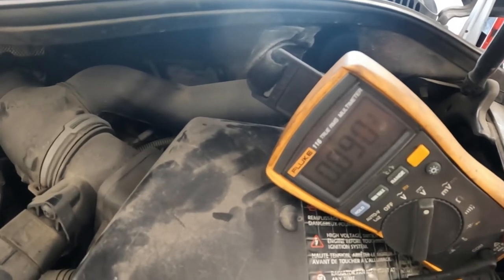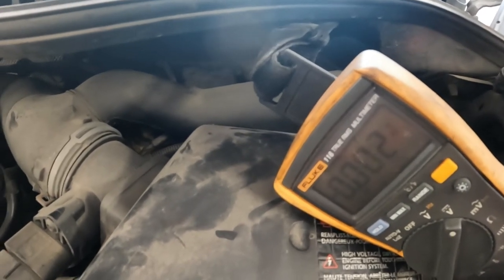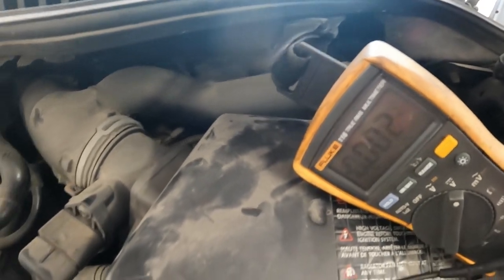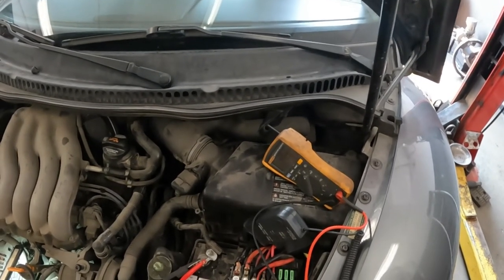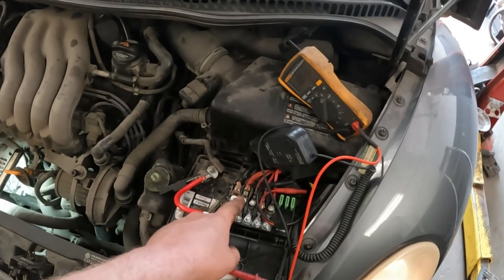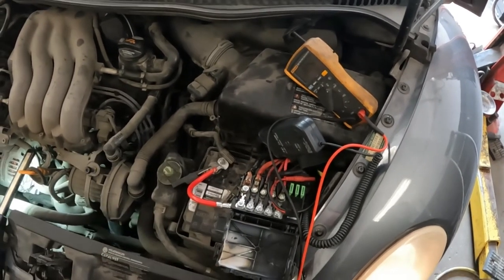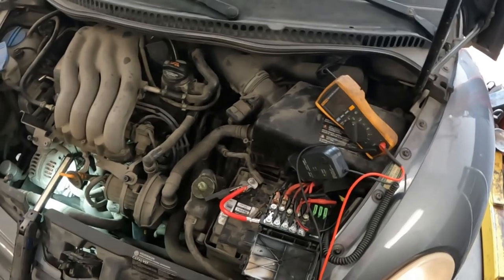So the whole copper wire is another 80 or 90 millivolts. If we were to change that whole copper wire, we might get that down from 90 to say 30, so instead of 160 we'd be down to about 130. Maybe we could drop another 10 and get it down to 120. In the grand scheme of things it's still not that warm. When we first fired it up it was smoking. I believe especially once this battery gets charged it'll be good to go. Thanks for watching.